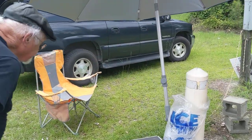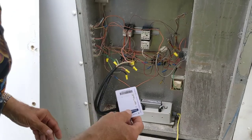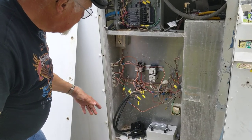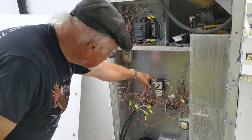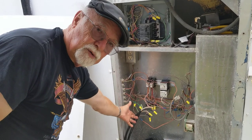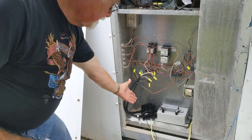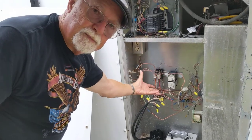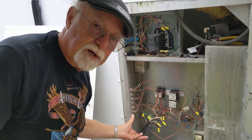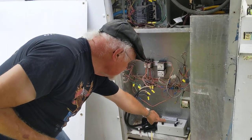Coming around here, here's what we did. We went to the control panel and real simple, we went to their control relay here, which is powering 220 volts. I disconnected their incoming and outgoing and connected our incoming and outgoing for 220 volts. So we're powering our controller, the bill acceptor, and the credit card terminal off of their original power. It's only four wires — six wires if you count the grounds. So we've got everything grounded, passing 220 volts into our control module and out.